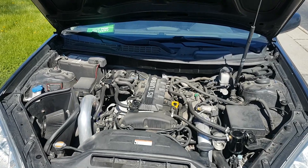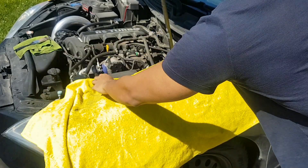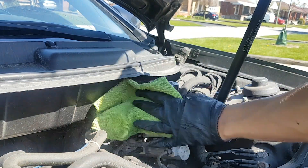When you pop the hood, we're looking for the brake fluid reservoir — that's going to be this tank in the back over here. Because brake fluid can strip the paint, we're going to put a towel down. We're going to start off by cleaning off all the dirt and contaminants in the surrounding areas, then just wipe down the area.